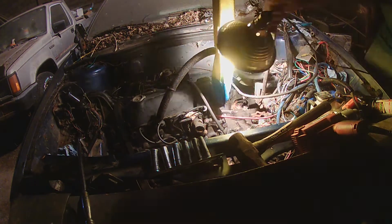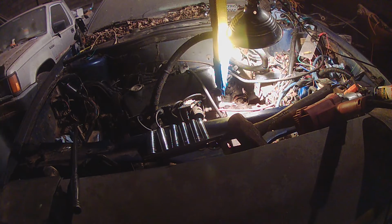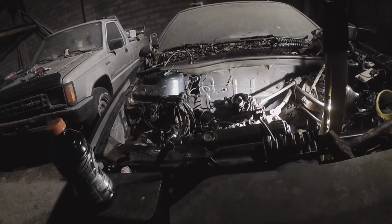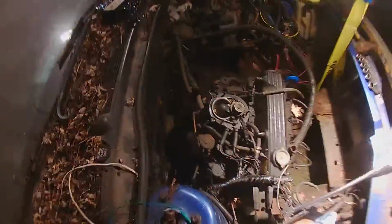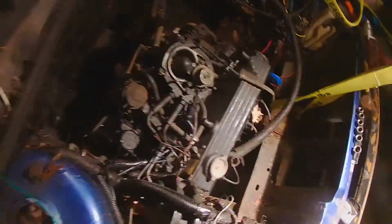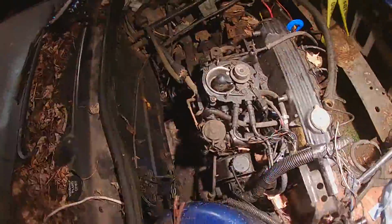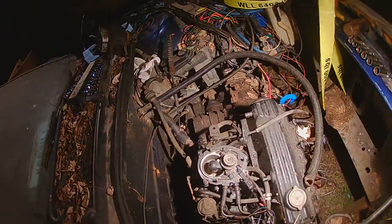Alright, so on the left side, look to the left and down from the top of the timing belt, and you'll see there's a bolt hole there. There's two bolts, a stud and a bolt, that go through the engine mount on that side and disconnect it. That's on the passenger side. On the front, there's just a big long bolt that goes through, but sometimes people torch it and it welds itself to the rubber insulator so you can't get it out. So there's 2 nuts and a bolt on the bottom of the core support. You can take it out with that. That's easy. Then on the driver's side mount, 1 bolt, and then you bang it out through the fender, through the driver's side wheel well, and then that mount just drops out too. Although in my case, the mount got hung up on the other side of the mount, so I had to pry at it to make it come down, but we got it.